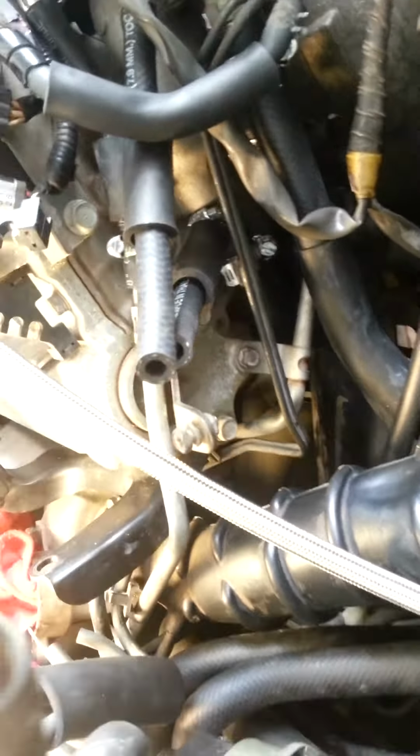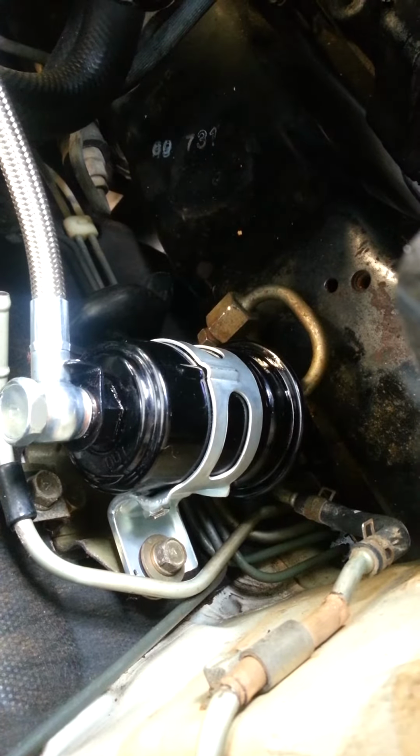So once that's installed, I did the fuel filter, and on the fuel filter you'll notice that on the bottom you'll have to transfer that U-shaped pipe to the new fuel filter. And so I suggest when you thread it back on to do that first, before you bolt it up to the firewall, at least hand tight. And then you'll need, I believe, a 19 millimeter and a 14 millimeter line wrench on the bottom.